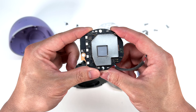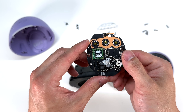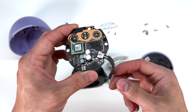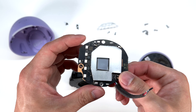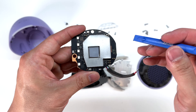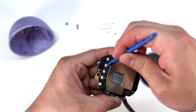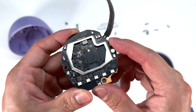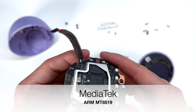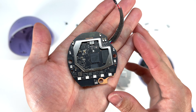The main board pops off the Amazon Echo pretty easily. At the top, we have a row of five LEDs. On the back, we have the volume up, volume down, and mute button. These black dots are for the microphone, and this connector goes to the power connector. If we remove this heat shield with the thermal tape, we can see the ARM processor and RAM. Under the covers in the center, there is a MediaTek ARM processor, and at the top is the RAM module — I'll list those down below.